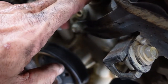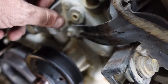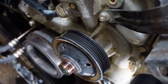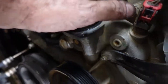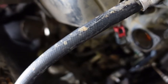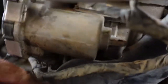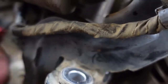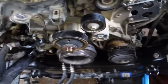So I'm going to pop this temperature sensor, which looks to have a double lock. Up there, double lock, and start disconnecting the rest of these, all these bolts. There's about a billion of them, hopefully. Alright, if you take off that 13mm nut down here and pull the little 13mm bolt out of there, you can finagle that bracket out of the way.